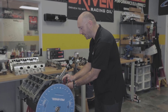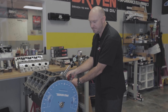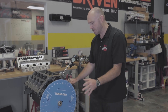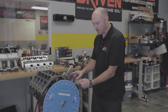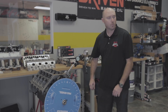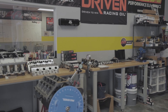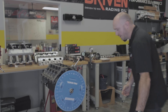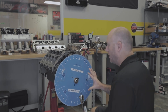Then I attach my timing wheel and timing gear here to the front of the engine and by eye locate it near top dead center, because we want to get it very precise by measurement so we just need to be in the ballpark. I've got my indicator here with an adjustable glass window and my timing wheel on the front of the block. I'm going to take a little marker and sit down where I can look closely and see my wheel.